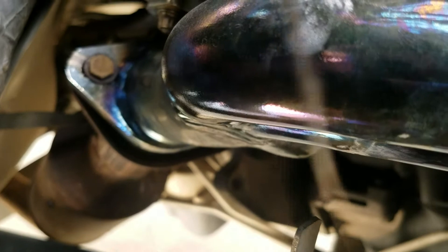You're going to want to put that exhaust gasket sealant on the flanges, or else you're going to have an exhaust leak and you're going to have this horrible puffing sound — I hate it when that happens. The funny thing is the finish actually looks pretty good, and it's been on there for about a year and a half now, so it looks great.